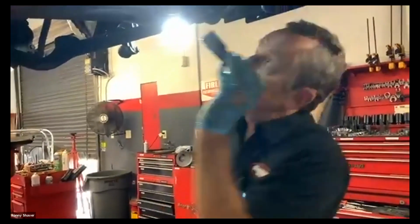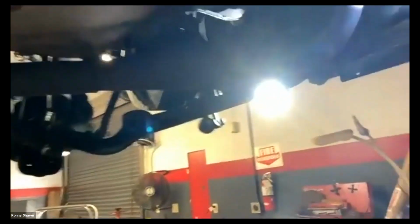So another place these like to leak, let's see if we can see it on this car, you can see this has a slight leak. I'm going to get my pointer up there. It's right there. You see this little rubber piece there? You see it? Oh, I'm glad they can't see this position that we're in. This is the front engine cover, this big piece at the front. It's two pieces. Down the center of it is a split. I don't know why they did it that way, but that's what they did. So in between that split is a rubber strip, they call it the cat turd, that is glued in there, and it's supposed to seal. After time, that rubber strip gets dry and shrinks, and you start to get the oil leaking. It's a real common problem on these cars all the way up through the Arnages. The fix is to take it apart and put a new strip in there.